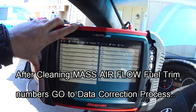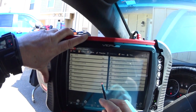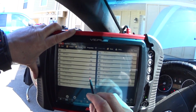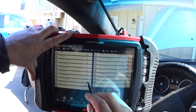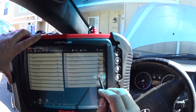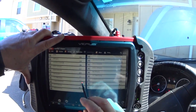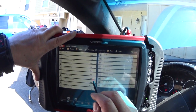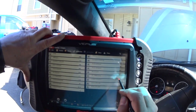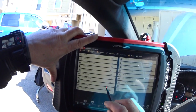Okay guys, this is what I got now. Before, my fuel trim numbers were a positive 9 or 10. This is the fuel trim number in bank 2 — now it's reaching up to 6, 3.9, negative 8. The computer right now is correcting these numbers because it's seeing — look at the fuel trims in bank 1, it's correcting. When you see that negative 5, it's correcting the fuel trims. So that means before I got positive 10, and now it's going to negative 5 — average that out with the positive number.